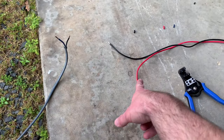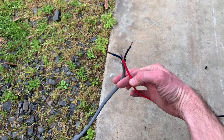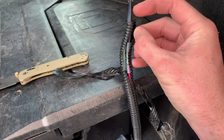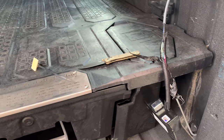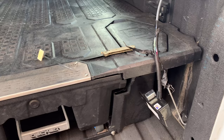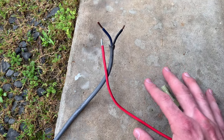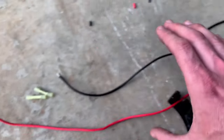I've got both ends skinned. I was going to assume the red was going to be with the blue, and I'm glad I stopped to think about it. I just undid this wire loom right here, and the red wire is clearly butt spliced to the black. I mean, I'd have just blown the fuse — it would have buffed, I'd have been fine, but this saves me a little time. So here are my butt splices. I'm going to butt splice them together, crimp it, and then put some heat shrink on them too, then run the wire loom down it.